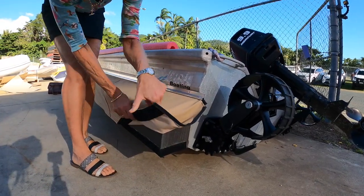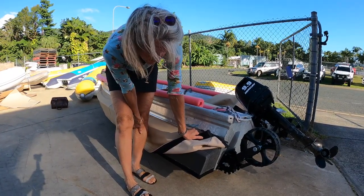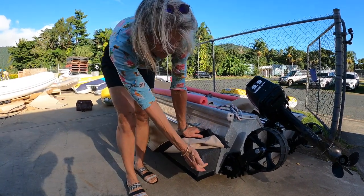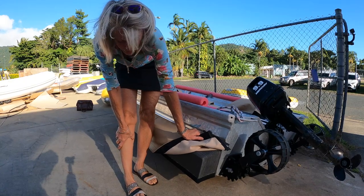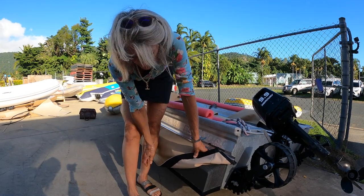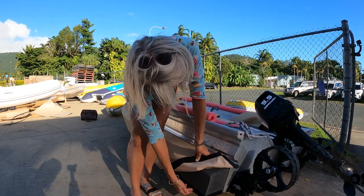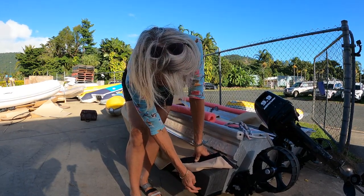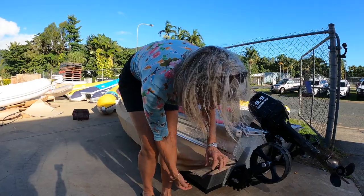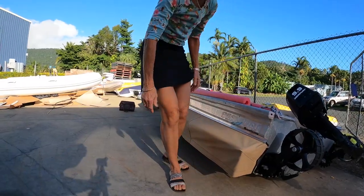Underneath the cover, we had to do an experimental couple of different ways of attaching Velcro to this foam because the foam, one, MEK would eat it, and two, our good glues are heat activated, so I needed to make sure it would work. Gluing the Velcro on was not an option, so we needed to stitch Velcro to heavy duty PVC, and then that PVC is glued to this foam. So it's a three coat glue system, two pack glue and heat activated glue. So that's going to stay there now and protect the foam.